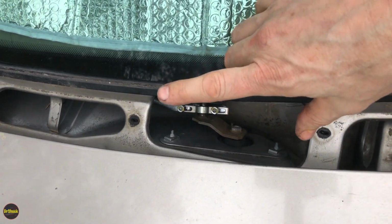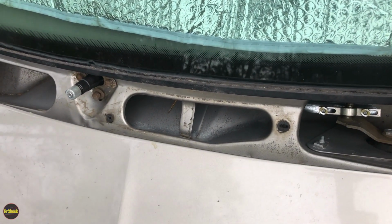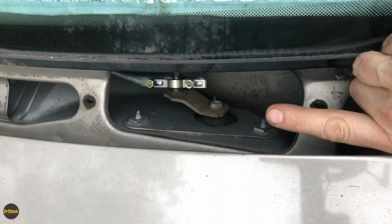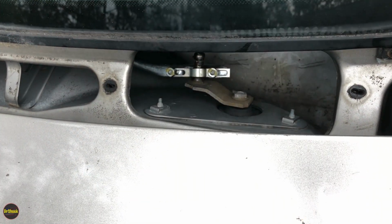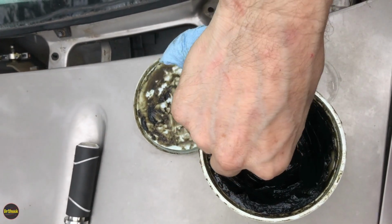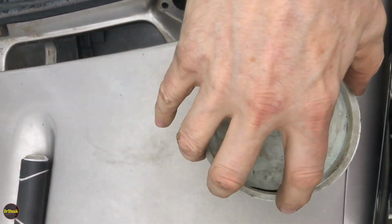All right, guys, if we take a look at the arm end of the transmission, we've gotten our bolts started, but we didn't go all the way. You may have to give them a crank with the ratchet because they are self-tapping into the new plastic housing. And you can see we've got the other end snapped onto the stud. It should be in this back area. You've got this piece here, an open area, and then the piece on the end that we're about to attach the last one on. I mentioned that this one did not come with any grease from the factory, so we're just going to add a little bit of wheel bearing grease inside of here. Not much, just to cut down on the wear.